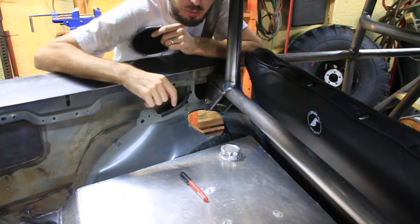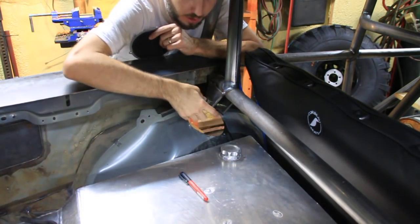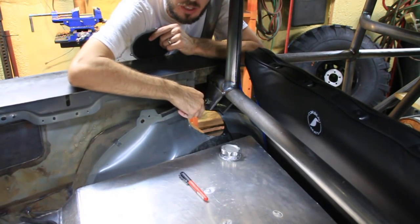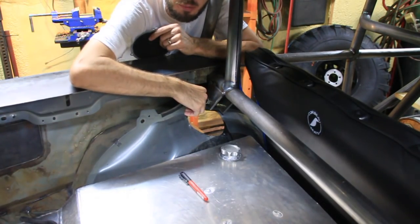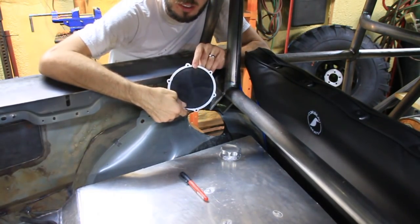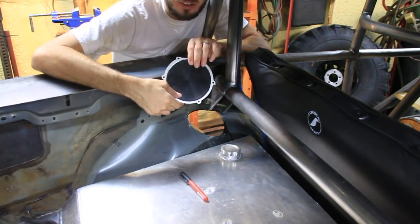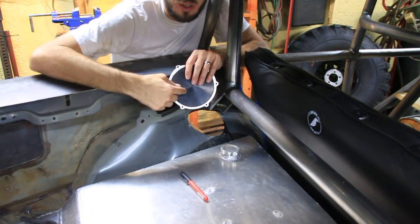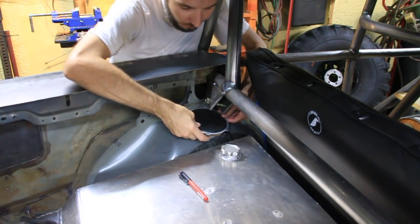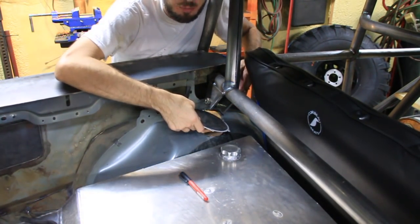So it seems like every day I have a new problem and today it's right here. I've cut this hole in my rear fender and I have the top shock mount right here. This hole is where the shock is going to go through to the axle. The shock has to move back and forth, pivot a little bit because of the suspension. So to combat that, I found this online — I got it on eBay but it's made by a company called Seals It. They make seals mainly for going through your firewall, putting wires and stuff through. This is the largest seal that they make, and I'm going to use it to seal this off and try to keep mud and stuff from coming up through.